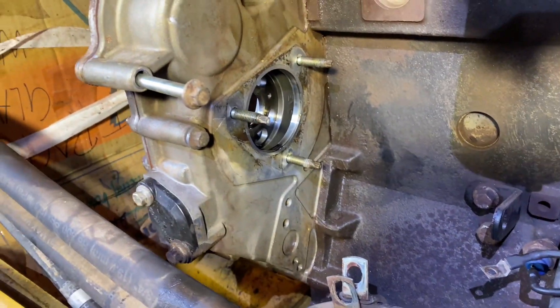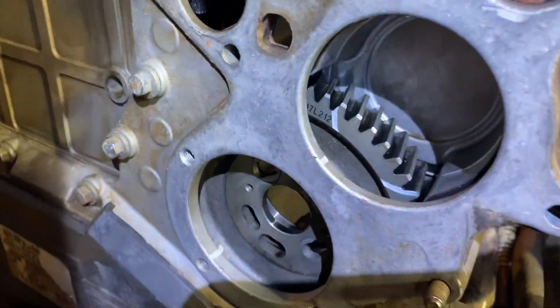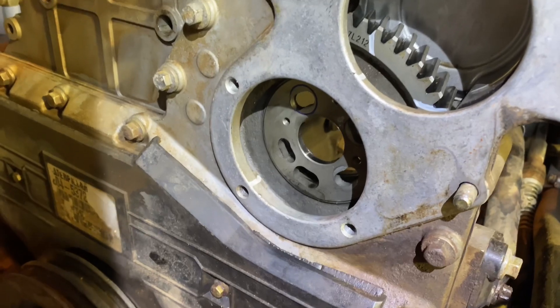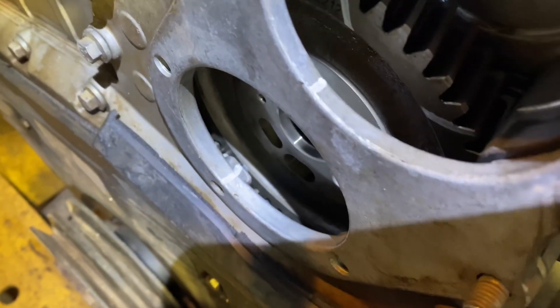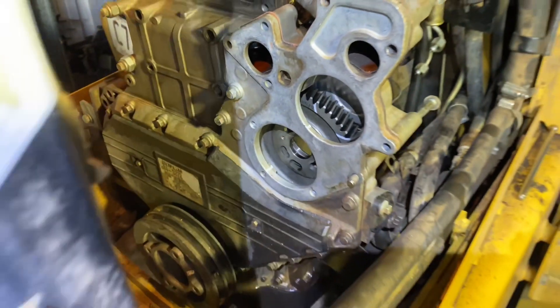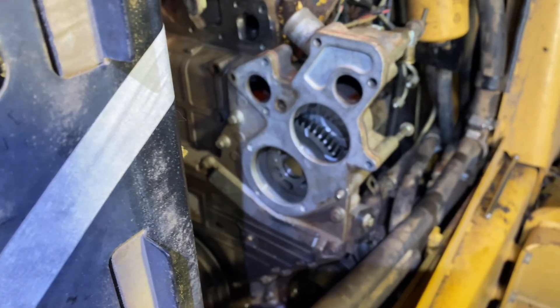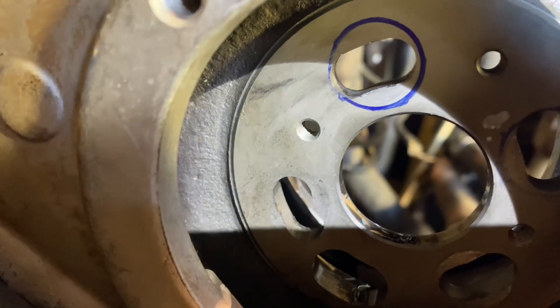The pump's off and the cog is still in there - you don't have to take the cog out, it just sits there. Don't let it fall out of its teeth position. I've got some marks down in there and as long as I put the injector pump back in with all those marks lined up right on the smack, it'll be right.